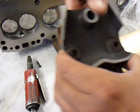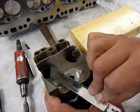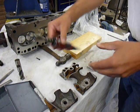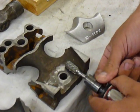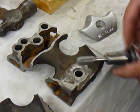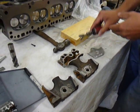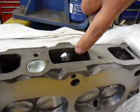This is just a cut-apart head for you to see. On the bottom side of the head when you go to cut through it, do the same thing, being careful not to cut into this area of the head. Keep your blade back and cut it off. Once that's done, I like to take a high-speed air grinder with a carbide bit and grind this area smoother. It doesn't have to be ground into the head — just grind it smooth. You're just trying to get rid of the old bolt boss and get it smooth. Do the same thing to the top side of the head — cut it and just grind it smooth. You can see the top side of the head right here in this port, and you can see how I've ground it smooth.